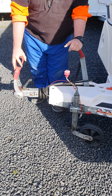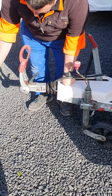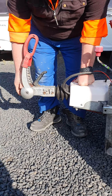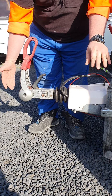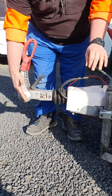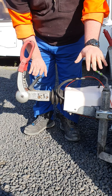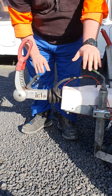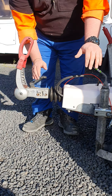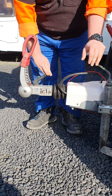With your hitch assembly, back your vehicle up and get it as close to the tow ball as you can. You can use your jockey wheel to lift or lower it if needed. Once you've got the tow ball underneath, use the jockey wheel to lower down onto the tow ball. When it's down right onto the tow ball, that lever there pops down and snaps down, letting you know it's on properly.